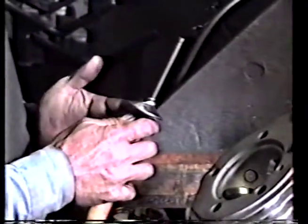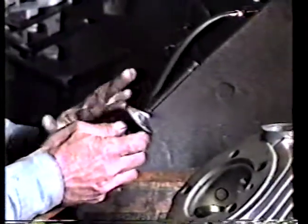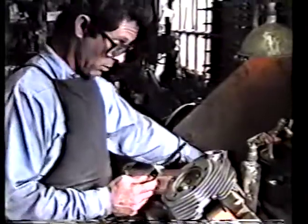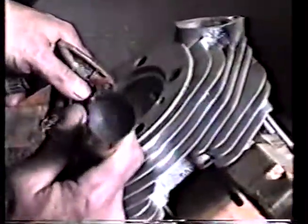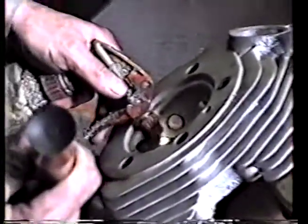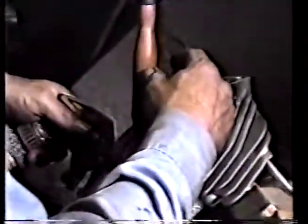We've got a tricky mix of valve grinding compound that's required to cut these seats because they're so hard and tough, and sometimes we'll have to go in and do it a couple of times. We also use some cutting oil — just a couple of drops usually will do it.